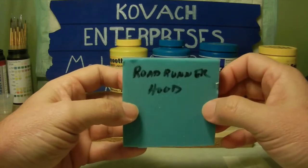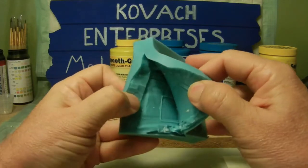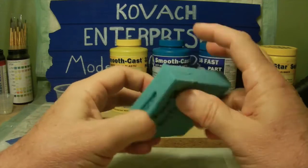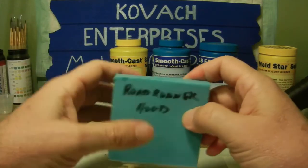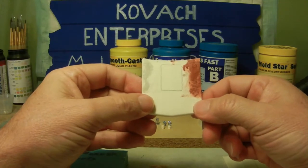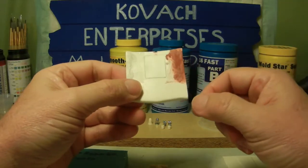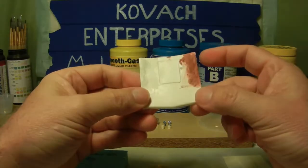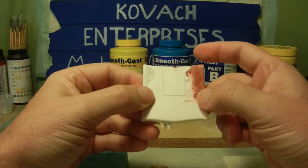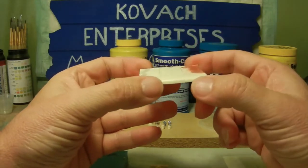For the second option, I made another mold — this is the Roadrunner original hood. You can see some of the impressions inside the mold. What I came up with was using my resin copy, taking a Dremel to knock down the two side ear scoops to make them more flat, then coming back and building it up with glazing putty and epoxy to give it more of a flat look.